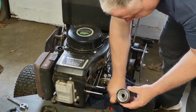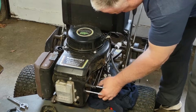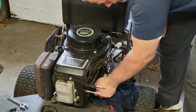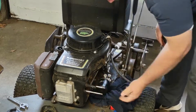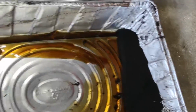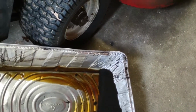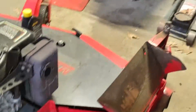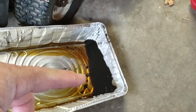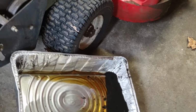Before you put the new oil filter on, dab a little oil around the O-ring. And only make it hand tight. There's your drain plug. So reinstall the drain plug. And that's how much oil continued to drip out. So that's probably, I don't know, half a pint at least. So even though the extractor there extracted probably half a pint, I had another pint to go in regards to oil. That's kind of somewhat disappointing. Doesn't get down as deep.